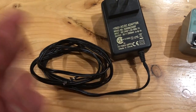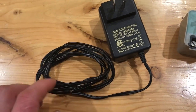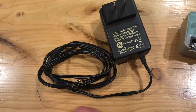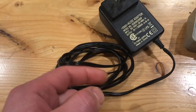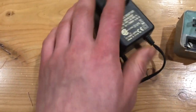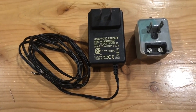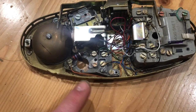It'll make the filament go out faster, so if you care about your filament you could get a lower power, lower wattage adapter and make it last a lot longer. You could also put a resistor between the actual power connections for the phone and the adapter. I haven't burned out any bulbs but it can happen faster, so hopefully troubleshooting light bulbs and your power supply connections should be good enough.